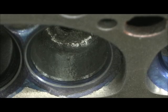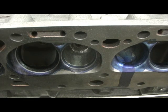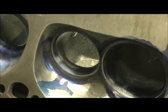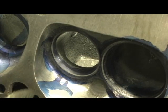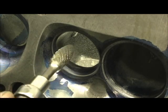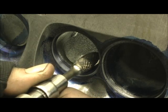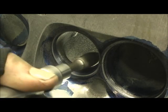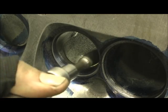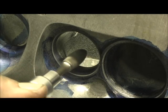I'm going to continue on and turn the head the other direction because we're going to have to rotate to get the short-turn side and pull it up. Now we're on the short-turn side. That's a pretty big ski jump even by my standard — let's try to pull it in. Notice I'm using the belly part here to start the digging because you've got to really watch it. You don't want to go too crazy — the exhaust will bust through really quick. Just a slow transition. Mainly what I try to keep it is straight along the guide when I'm doing the first cut.